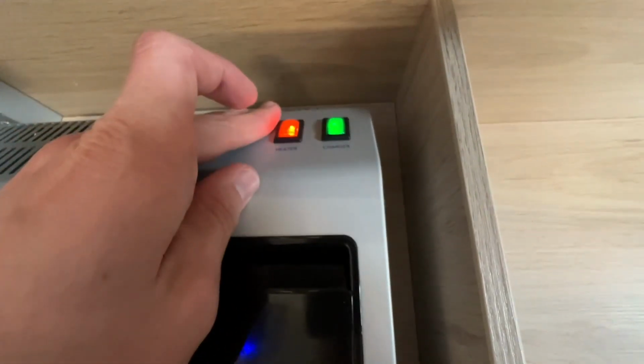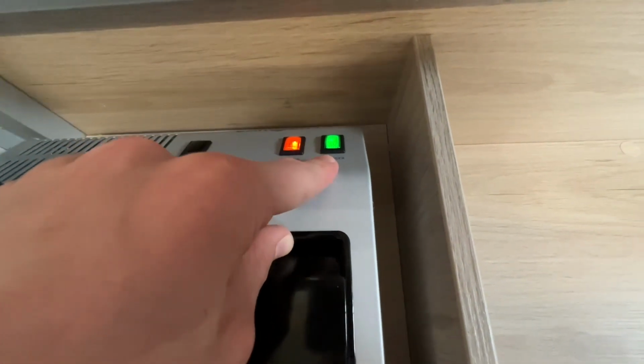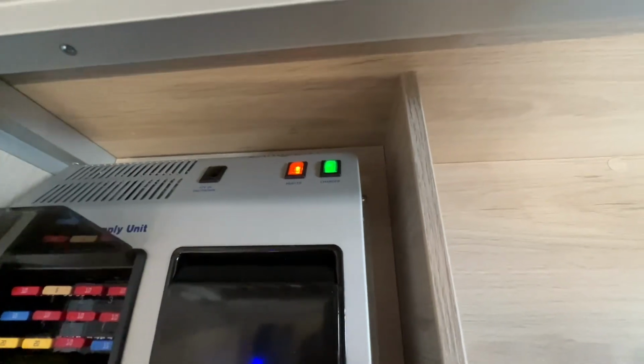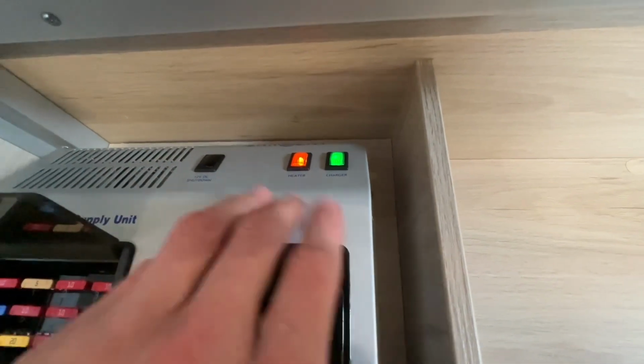This needs to be pushed in and illuminated for the heater to work on electric, and that is your charger charging your leisure battery on mains. Leave them as they are. If you have got any problems, this would be the first place I would try, just to see if these have been pushed out, but they should illuminate when hooked up.